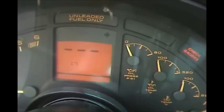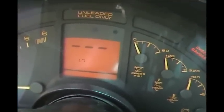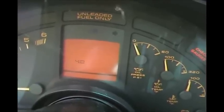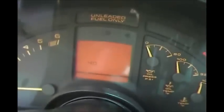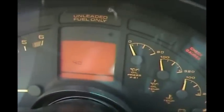To clear the codes, come over here and hold the English metric button until it beeps — that means you have cleared the codes. If you want to go through the other computers, just press your trip button. If that trip button doesn't work, there's a reset trip button down below that will get you out of the clear mode.